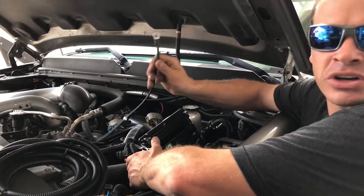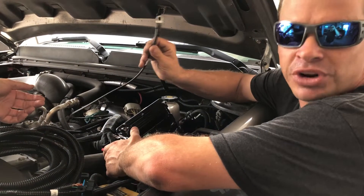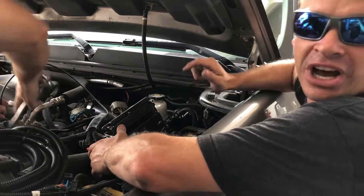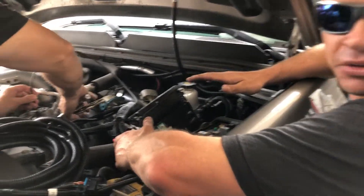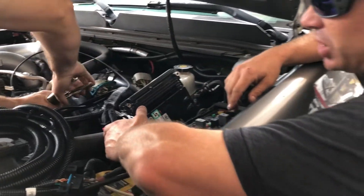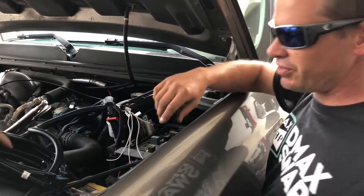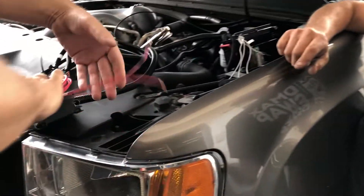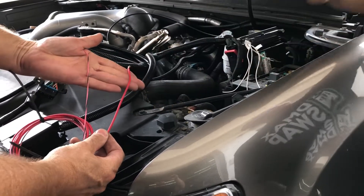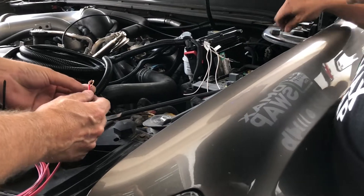For our purposes right now we're just gonna connect to one of the accessory brackets, but you do not want to do that when you're doing this on your truck. It is critical that this wire is connected directly to the iron engine block — somewhere down near the motor mount there are a bunch of threaded bosses where you can connect it. Then we've got the other two wires critical to making it run: your red and your pink wire. This being your constant 12 volt, and that's your ignition circuit to make the truck run.